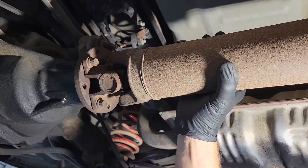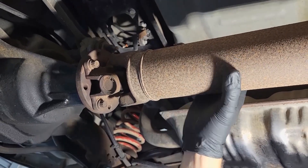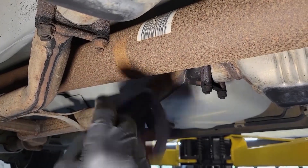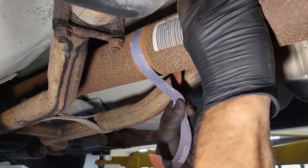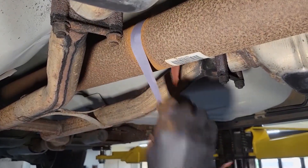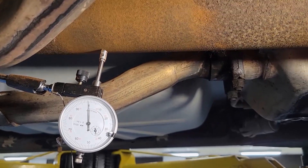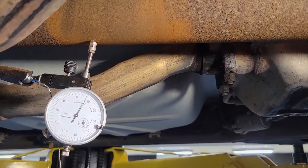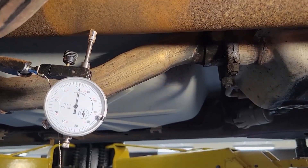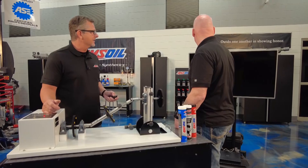Pick up and down on it — you don't want any play in those U-joints at all. Front and rear. There's your differential; the other one was the actual yoke up there. Give it a good pull and tug. If you want to make that measurement, it's pretty simple. It's going to take some emery cloth or sandpaper. Take off those major bumps or rust so you don't have any deflections on your needle. You'll have a little bit when spinning it, but not too much. Then just get your dial indicator and start putting it on your drive shaft, spin it around in those three places. If you have some major vibration or problems, it's going to show up on that dial indicator.